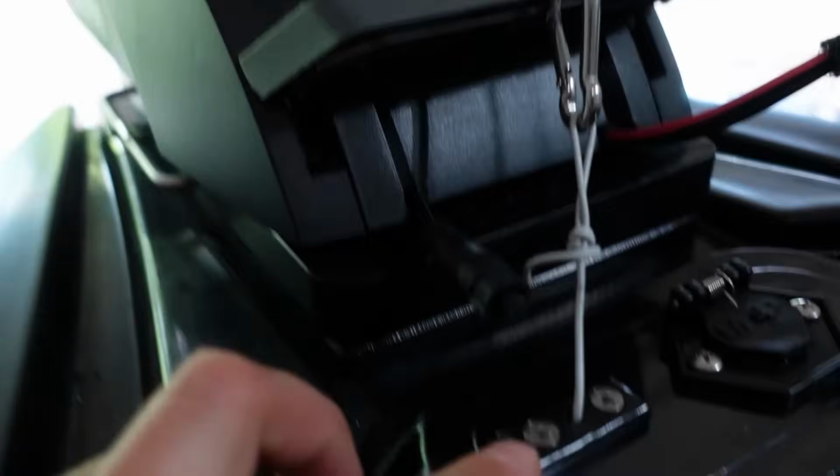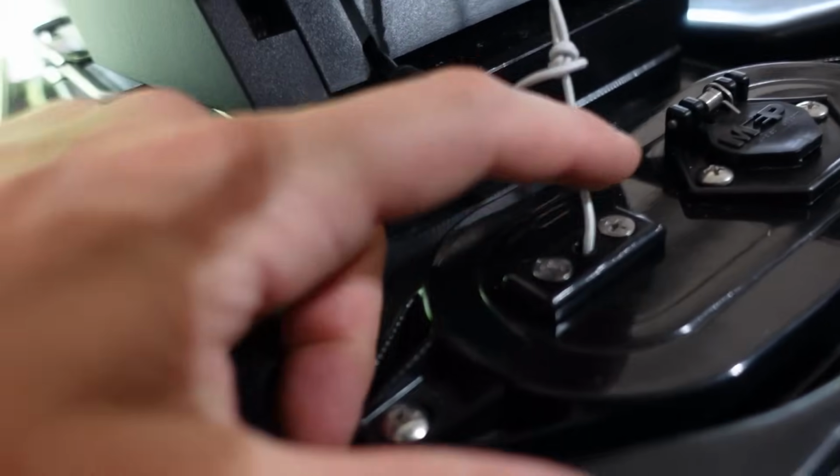You can either do the 1 1/4 inch and use a bunch of marine goop, or you can do the 1 inch and you're gonna have to cut out a little bit more of that space. So something to keep in mind. So 1 1/8 you need for that hole. Then you got this very simple bracket here, which is kind of open to the inside of the hull. Don't love that.